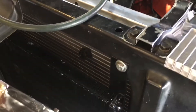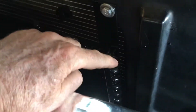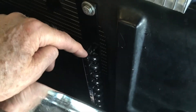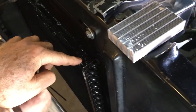Today's R134 system really needs a very good condensing action. Our condenser here — the very first thing I note is these are round tube condensers. Round tubes allow the refrigerant, 134A, to move through so quickly that it doesn't actually turn into a liquid. And that's what a condenser's job is — just like a still makes alcohol out of steam, we're going to make liquid out of a gas. Refrigerant comes through here and then gets turned into a high-pressure liquid.